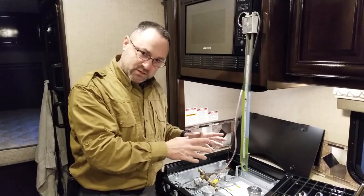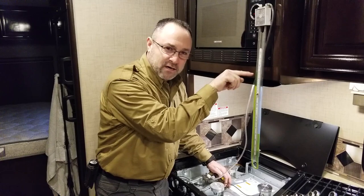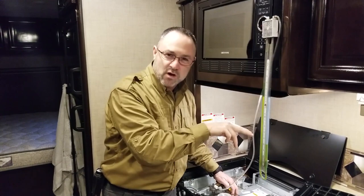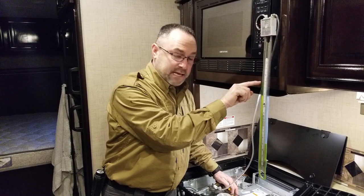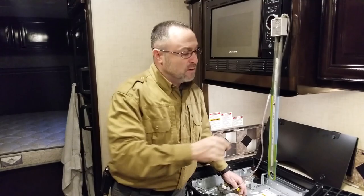That's your 50% load test. For the leak test: come off the pressure a little bit — I try to keep it between 4.5 and 5. If it goes too low there's not enough pressure to test for a leak. If it rises toward 11 or 12 inches, your service valve wasn't fully closed and you have a problem. If it drops down, you have a leak somewhere in the system.